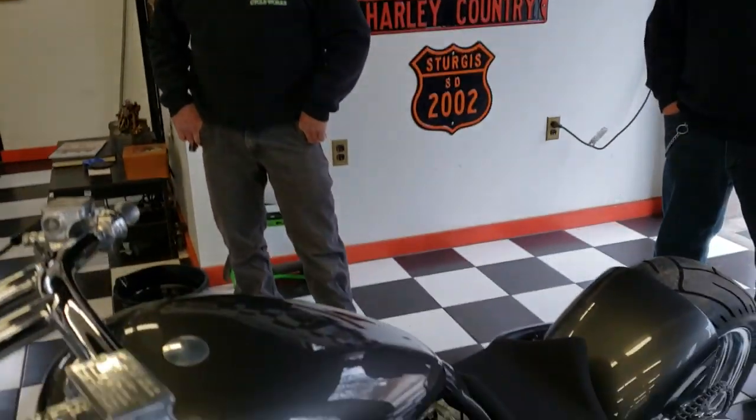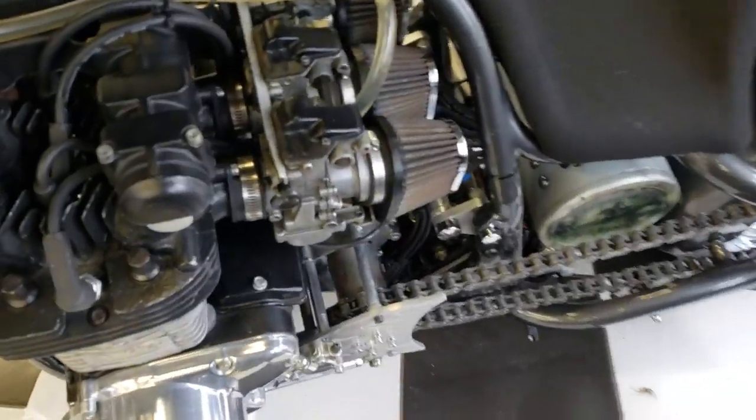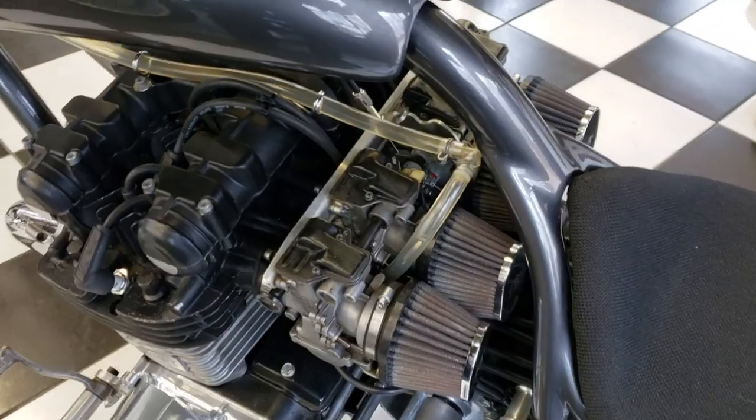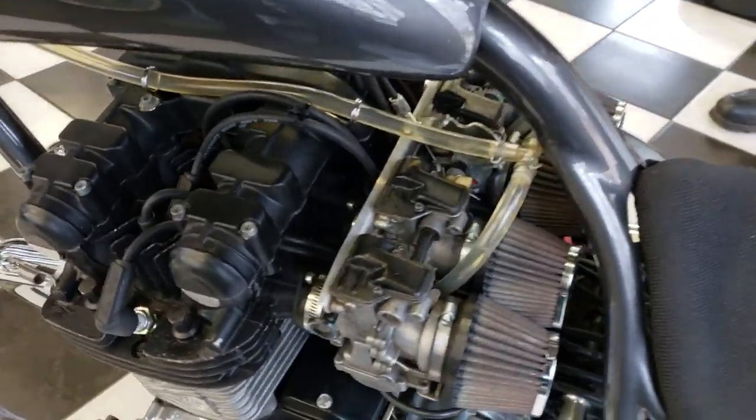Dan, you had said you weren't happy with the way the carburation was set up right now. There was a slight hesitation. I thought Jimmy might help, that's why I dragged him up here. I think it's over carbureted, to tell you the truth, because I did play with the jetting a little bit. It's running the best now with the combination of pilot jets in there right now. This would be an easy set of carbs for us to sell on eBay or something if you wanted to change to a set of smaller smooth bores or something. Yeah. What would you recommend?